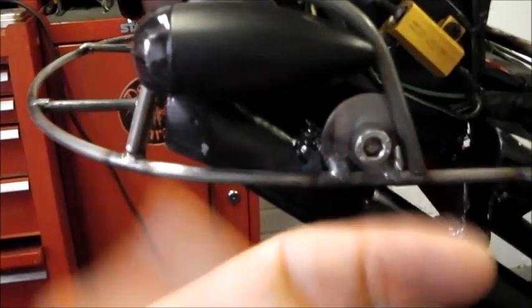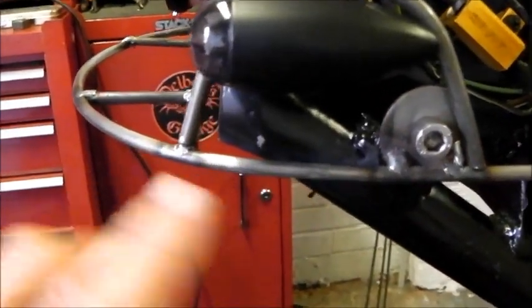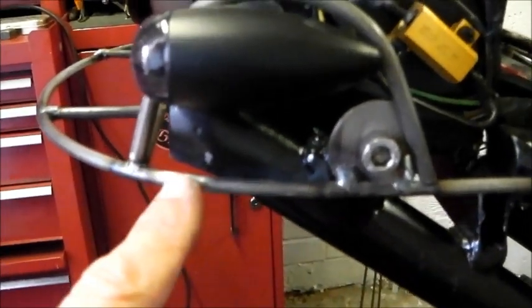So I've chosen to tuck it right down over as close as possible and use thick rod, which will give it strength, because if I'm cutting out this bottom frame and there's going to be a gap here, although there's fiberglass in the top and that will give it strength, that will definitely be a weak point. So that's the easiest way to cure that. Nice strong rod, curved over nice and tucked in and ground in there so that it's nice and flush. Now I'll get a good fit on that on the outside.